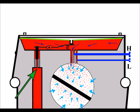That's simply because we won't have the same amount of flow of fuel coming past the needle there because it's only partially open. So there's going to be less up here in the metering area, which will lead to less being available to be given by the main jet. And finally, as we've mentioned, will lead to less being available here in the inlet for the engine.